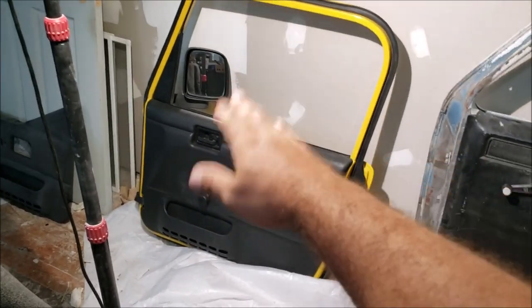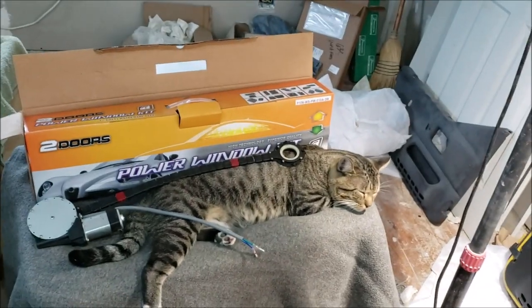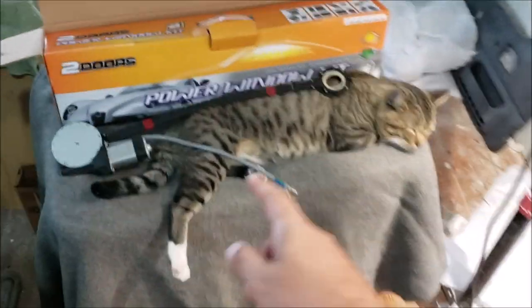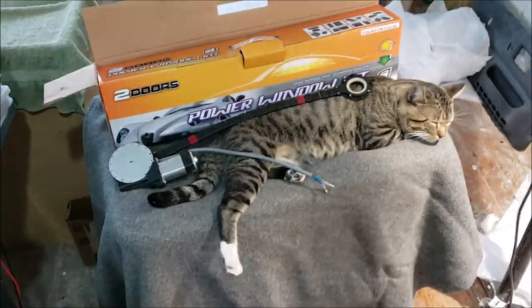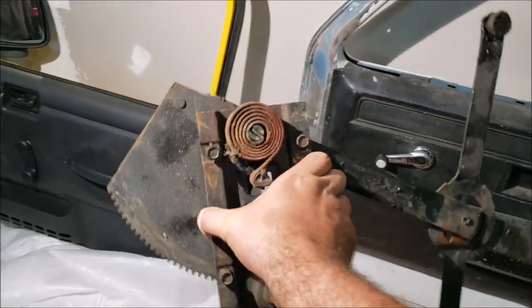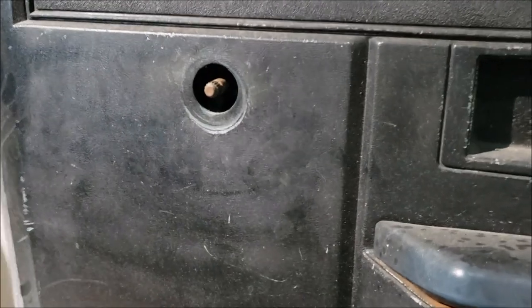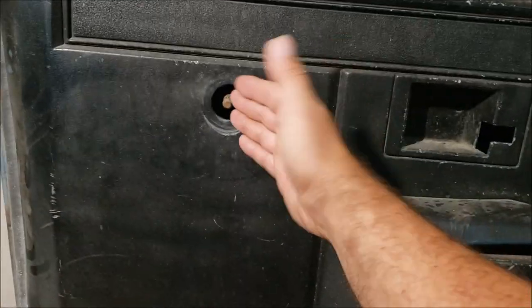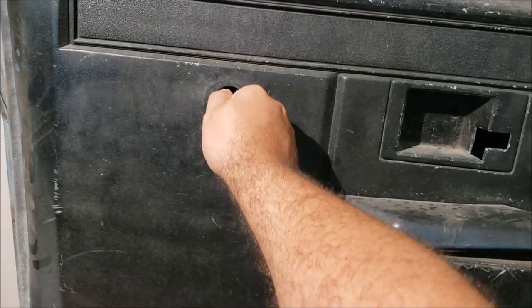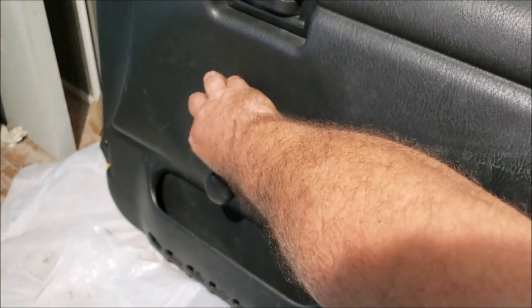I'm going to go up and down with it and give you my honest opinion. You have to make modifications to your door panel so this thing has to pass the test. This is a power window kit — it is not a conversion kit — because these are manual roll-up windows. Manual windows use a regulator with a stud that the handle attaches to. This kit does not modify or alter the manual regulator in any way. So we're not converting to power windows; we are power-assisting manual windows — the motor is rolling them up for you.